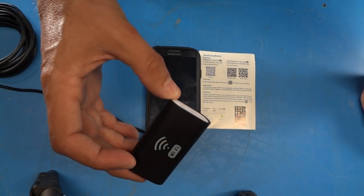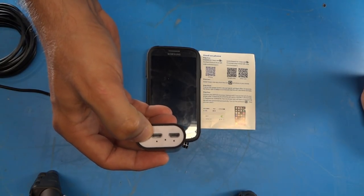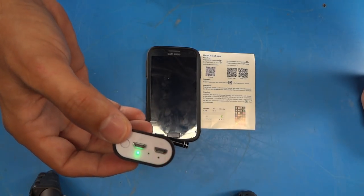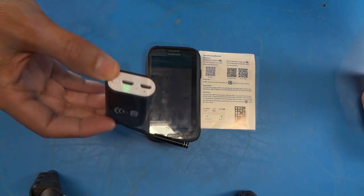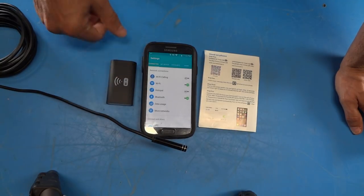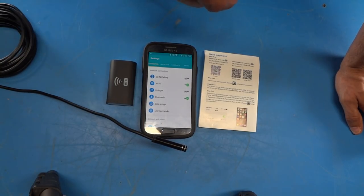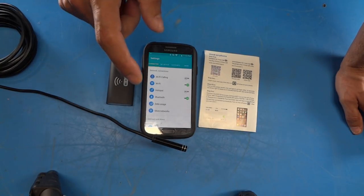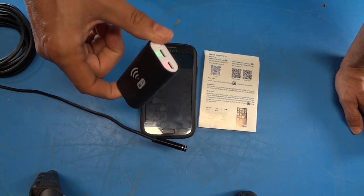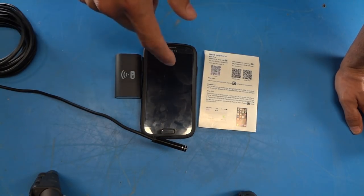The next thing is to get the Wi-Fi module, turn it on by holding the power button for about a second until the lights turn on, then wait 10 to 15 seconds for the Wi-Fi transmitter to initialize. When I first tried this on my phone, I could get the Wi-Fi module to connect but it would stay connected for only about 30 seconds and then automatically disconnect. What I found was that I had to go into the deeper settings on my phone and enable the network for this device to be persistent.